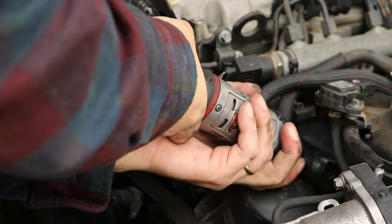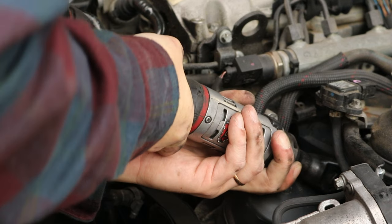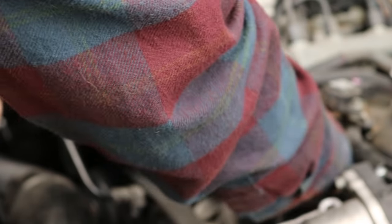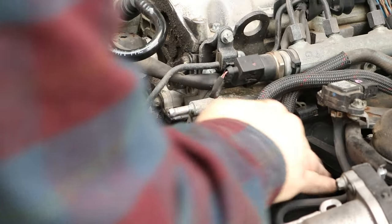And then you've got the thermostat loose. Just don't drop any of the bolts, they're not captive, so back them out fully while applying pressure into them so they're spinning in place, and then pick them out with either pliers or your hand, you know, dexterity. So yeah, once you've got it off, then you can start to wiggle it out.